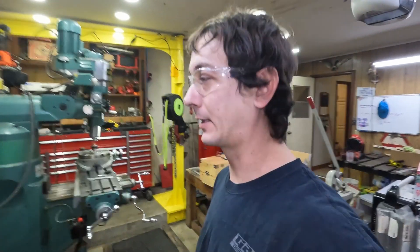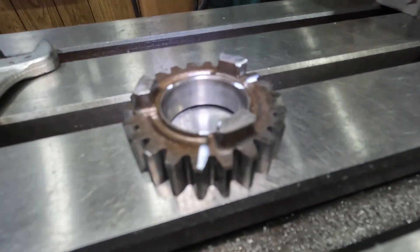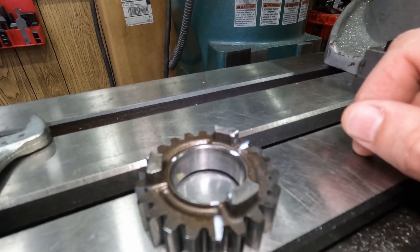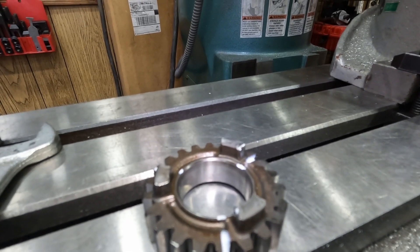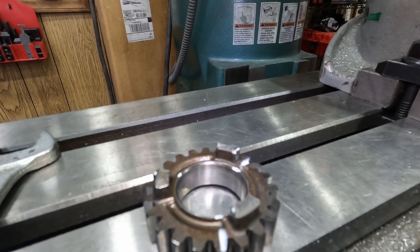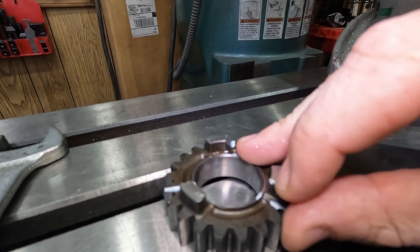Let me show you what we've got going on here — what back cutting is and why we do it. The problem is these transmissions like to bounce out of gear. It comes out of basically any kind of four-wheeler, ATV, street bike, anything that you're hard on. If you're hard on shifting or shifting without a clutch at the wrong time, it can get to where they like to bounce out of gear. You'll put it in second or third gear where you've got a lot of torque and leverage, and you'll throttle up and it'll bounce back to neutral. You can tear stuff up too — they can bounce into two gears at once, which will split the case.